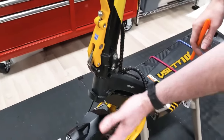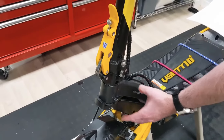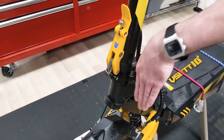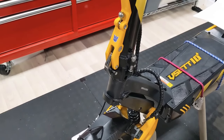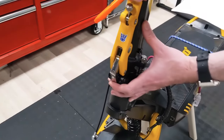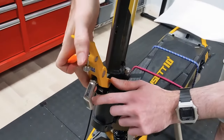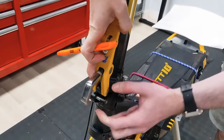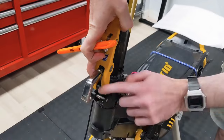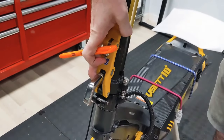All of that is to address noises from creaking when the steering column is moving back and forth. There are a couple other points you can address. This hook right here — sometimes dirt or something can get in there. You want to clean that out and make sure that both surfaces it hooks onto and the hook itself are clean. You can throw a tiny bit of grease in there as well; it does not hurt.